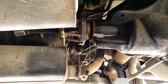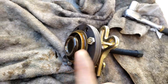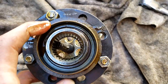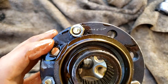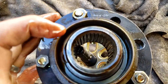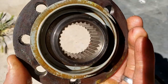There's going to be quite a lot of oil draining out, so make sure you have a catch pan. Here's how it looks with everything off the car. One note: you will not get this flange off with a hammer and chisel — don't even try it. The amount of force it takes to pull the splines loose is too much. Inside the pinion flange there is a seal surface that mates with the pinion seal. Clean this down with brake cleaner to make sure there's no debris, clean the splines, and put a tiny light smear of gear oil on the seal surface before putting it back on.